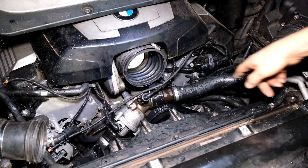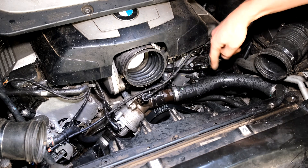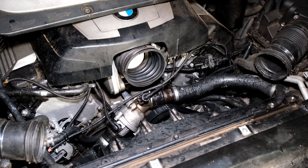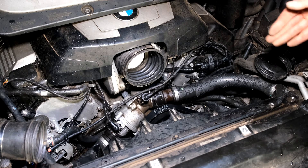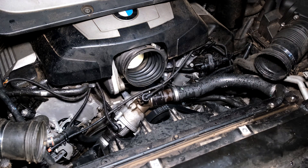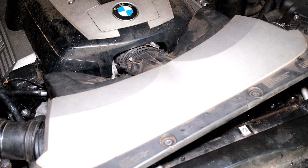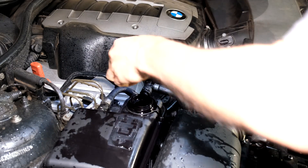I sprayed water inside there — obviously block that area so you don't get any water in the components. There's some antifreeze sitting on the plastic cover at the bottom. In the morning you'll come to your car and see antifreeze on the floor and think it's leaked. I've cleaned it and replaced it with water — water will evaporate much quicker, and I'll also be able to tell if the color is green, meaning it's an actual leak. Now put your air filter back and connect it, then idle the car for 15 or so minutes with the coolant reservoir open.